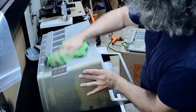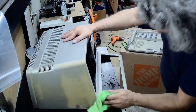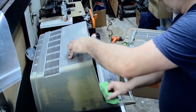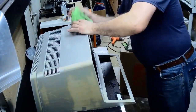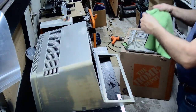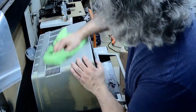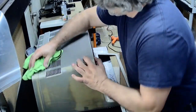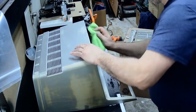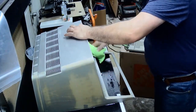I'm going to wipe it down, take most of the water out, and normally what I do is I leave it outside. I have a post that I put it on top of and I let it dry in the sun. I make sure that it's dry before you proceed to the next step. The dryness is important. Primer will not stick if it's humid or wet. It's a great way to have absolutely zero adhesion and end up with a really bad paint job on your hands.